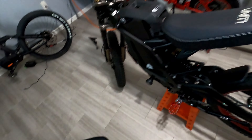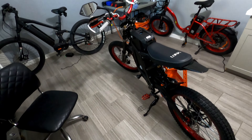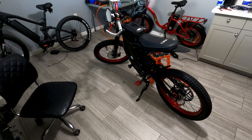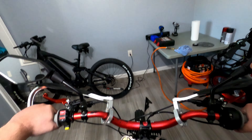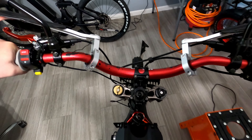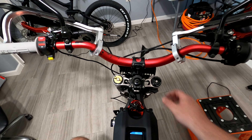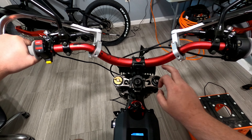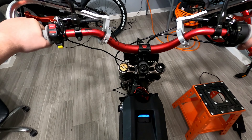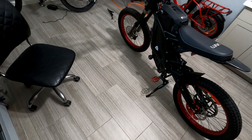Let's see if the kickstand still works because I may have to adjust that too. Cool, I don't have to adjust it. I like how the kickstand stands a little more upright now because it was leaning a lot before. So pegs are lower, handlebars are higher — the geometry should feel a lot better standing up. I also loosened up my suspension because it was too hard off-road, and it softened up a lot, eating the bumps much better. This is a KKE. I don't like this little bit of play here — I wonder if I could tighten something up.